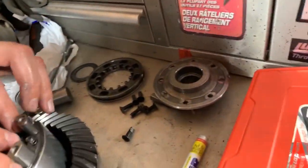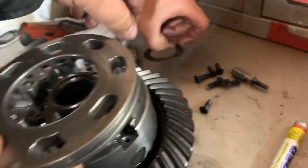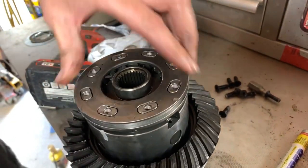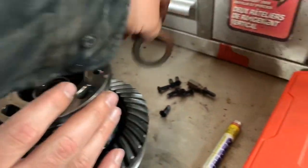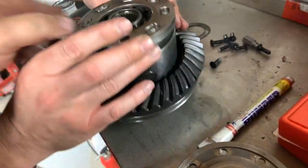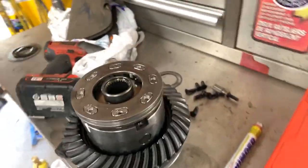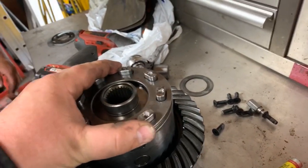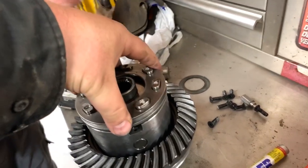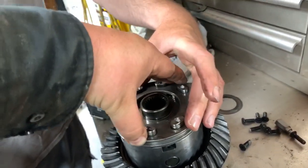Maybe it just had to be in a certain orientation. We had that spacer — that shim was stuck, but that shim's too small to make a difference because it was only going halfway. So if we just keep going in circles maybe it'll mesh. It won't mesh. Hold on — it does a different pattern every time. There we go. It was wrong from the factory. No, because your spider gears would turn this piece too.